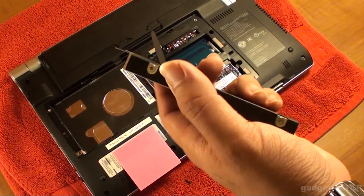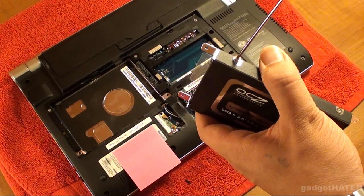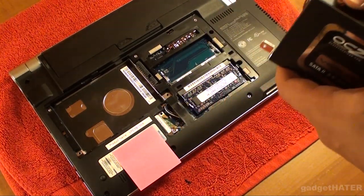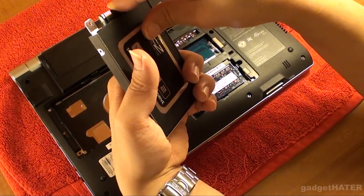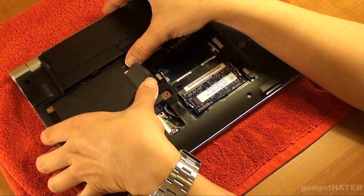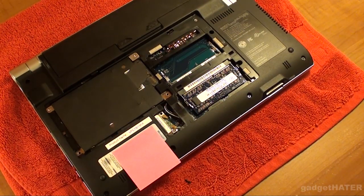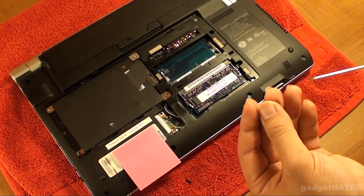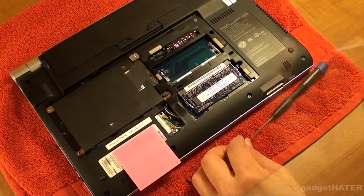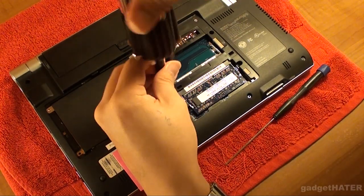As I was saying about the SSD, that's the best upgrade that you can do. You can see that you can unscrew those four screws there and then place the SSD within the hard drive holder, which you then use to insert back into the VAIO. Once that's back in, the connection is set through the notches — put in those two black screws right there, and then just replace the lid.